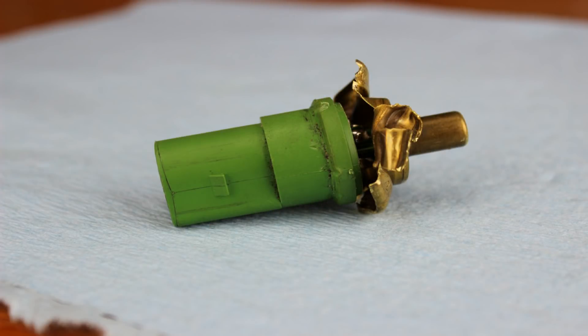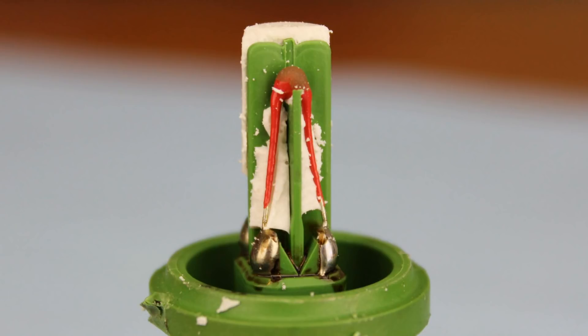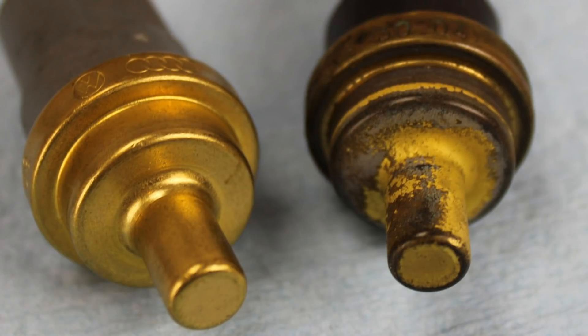So how does an ECT fail? Well, first off, it can leak. It can leak from the seal that sits in the housing, or it can actually leak from where the plastic meets the brass. There is a tiny seal it can leak from. It can also leak in a very unhappy way — through the electrical connection. I've actually seen that cause coolant migration, where the coolant will come up through the sensor and go all through the wires, making a very unhappy vehicle and in turn a very unhappy customer. But a more common way they fail is a broken connection inside of the sensor. As you can see here, there are a lot of little connections inside the sensor, and at any weak point that can be a failure — either a static problem or an intermittent problem. You could also have a coolant issue causing corrosion or some sort of buildup on the brass portion, and that may impact the ability for the ECT to read.